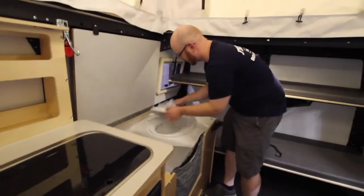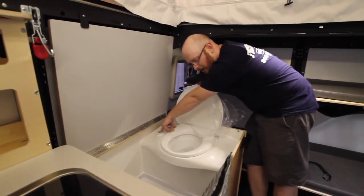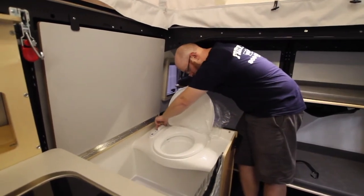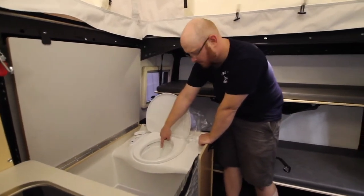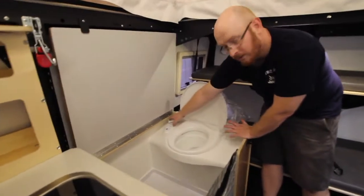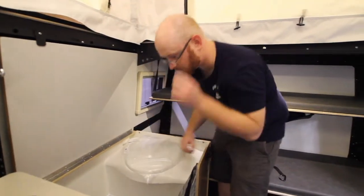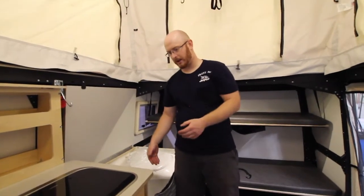You have your toilet remote. To use this, make sure you have your battery disconnect on. Hold this fill button. If you're going number two, fill the bowl. Once done, pull it back and flush. I recommend filling this up just enough to cover the little black valve, then leave that there when camping. Once you're ready to go down the road, open it and let it drain out. This is the only section that goes into the black tank — all other drains go into the gray tank.